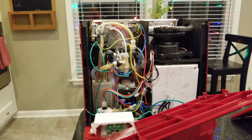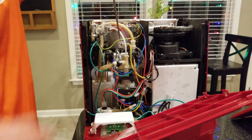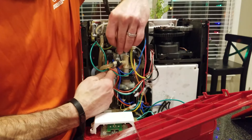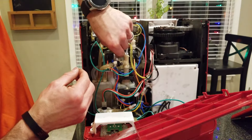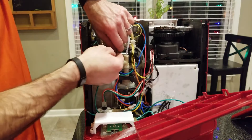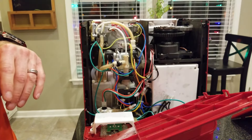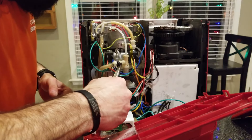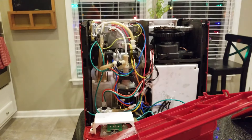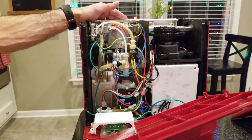Just going to pull this — it'll make a little mess but I'll clean it up later. Plug is disconnected. So just as before, it's a little more inconvenient: pull your clip, don't drop it, pull your line out, slip your O-ring on, spin it around a few times to help get it untwisted, then push it back down in there. Grab your clip — this time we'll use needle nose pliers — and insert it in there. And that's it, easy as that. We'll button this all back up and call it a day. Espresso tomorrow morning!